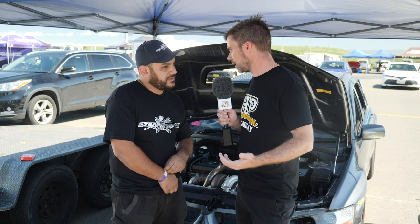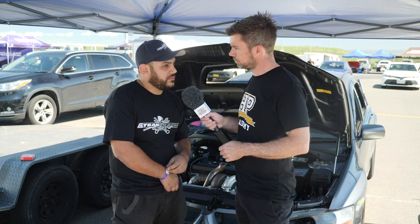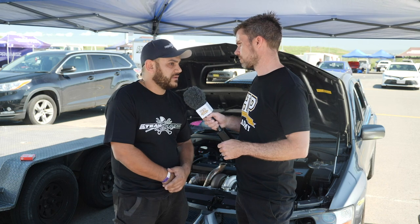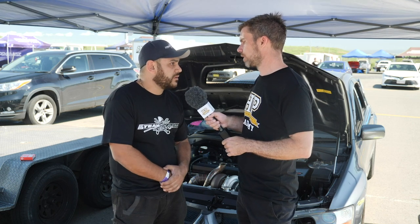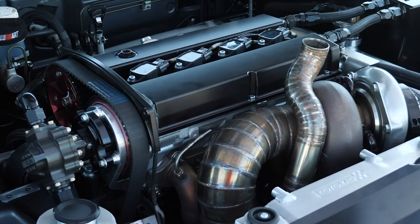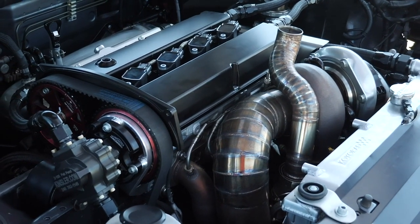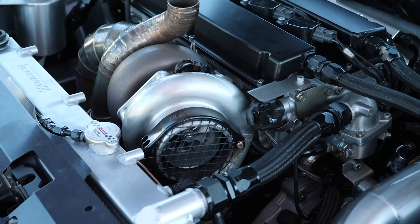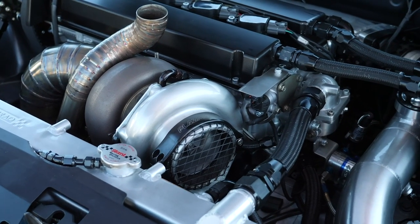Where do you see the advantages and maybe disadvantages of that setup? I like to keep it with the 63 block — reason being bore size, keeping the bore a bit tighter. The 64 starts at 86mm, this one starts at 85mm, just a bit more integrity in the block, and I find it makes just the same amount of power if not more. There's the old story that there's no replacement for displacement, but when you're running a turbocharger you can make up for a lot of displacement with a couple more psi of boost. The 64 block, particularly if you go oversize on that, you end up with a lot less material between cylinders and a thinner sleeve, so the 63 makes a lot of sense.